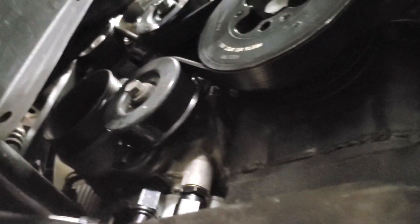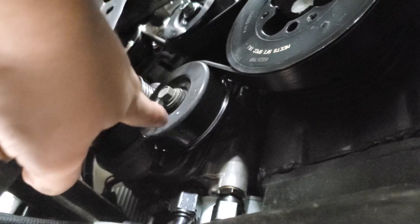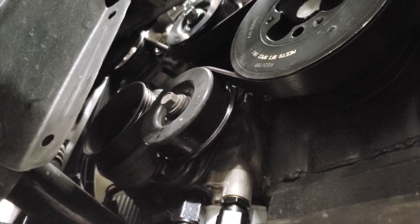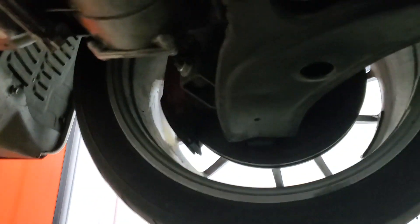If you're ever exposed to rain, you should run that plastic guard, because the pulley down here will get water in it and ruin that bearing — that can be pretty expensive. First time you drive through a really deep puddle, it's going to ruin that bearing, so you want to run that guard.